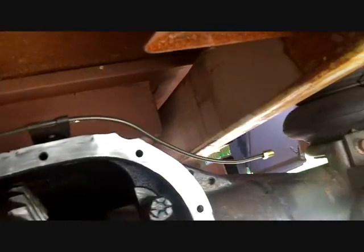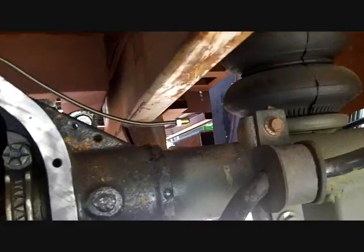And this one actually, with the brand new brake line, came out really nice. Goes up and over the pumpkin, the original clip. And then it ends there. I'm just going to put a Union. I think it was like 12 inches to make it around the corner. But I'm getting to the factory rubber fitting over here. And this thing is single flare, and it's got like 4 threads. That's it. There's nothing to grab.